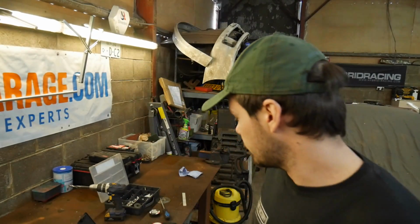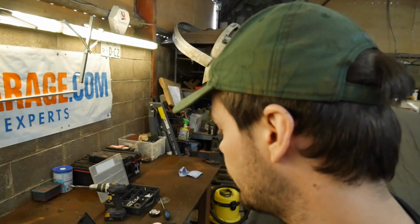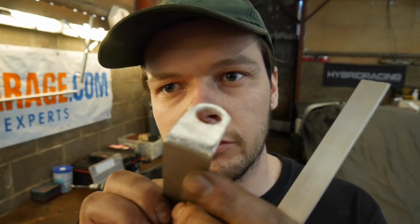And all I've been doing with this flat bar is going up, measuring it up. This is the longest one I've made, and I wasn't too keen about making that, but it's solid. So this alloy that I've got is from a different supplier this time from when I did the engine bay ones, and it has started to show some cracks, but I've just left it. We've bent it as it is. It still feels proper solid, and it's going to take the weight of the nozzle, no problem, but yeah, it's definitely not bent as well as the other stuff. Could potentially heat it up, I guess, to try and make it a neater bend, but because I didn't have to do that the first time, I don't want to do it the second time.